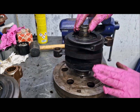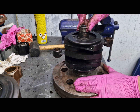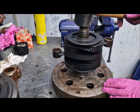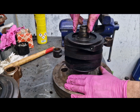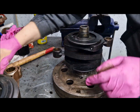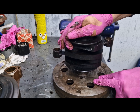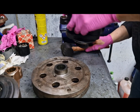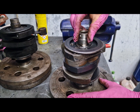Also, this was the original flywheel and crankshaft from the engine. With these originals you have play, and you can be fooled sometimes — if you push them together like this, there is no play and you are tempted to believe you have good tapers, but you don't. They are just forced into one another, and because of that there is no play. You will think 'it is okay' — but it is not okay. That is exactly why I made this work.